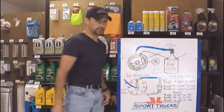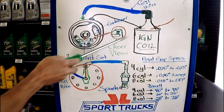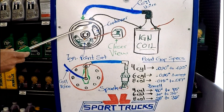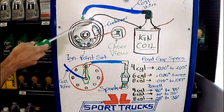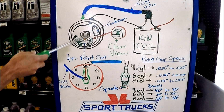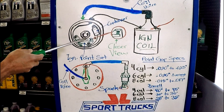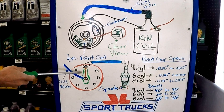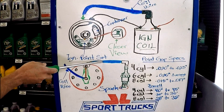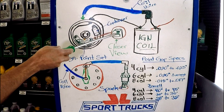Let's get this camera up close so you can see it better. Before we go over the operation, let's review the parts involved. If you watched previous videos you know how the ignition coil works. This is a picture of a distributor from a top view with the distributor cap removed. Inside the distributor that has the points and condenser you're going to see the point set and the condenser. This is the shaft where the ignition rotor goes mounted on. This is the cam of the distributor that opens and closes the points. This is the distributor cap, this is the ignition rotor, this is the spark plug wire, and this is the ignition coil wire. And this is a closer view of the point set.